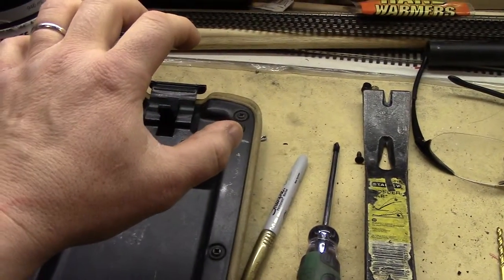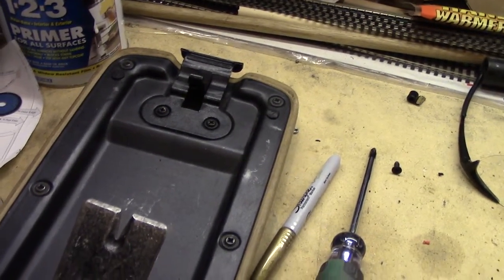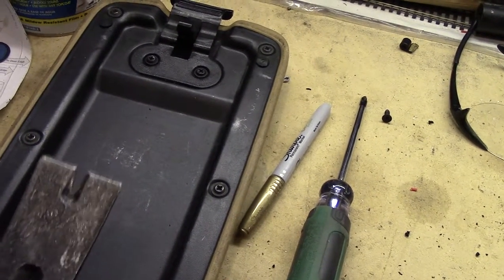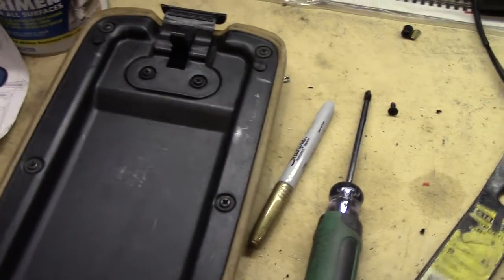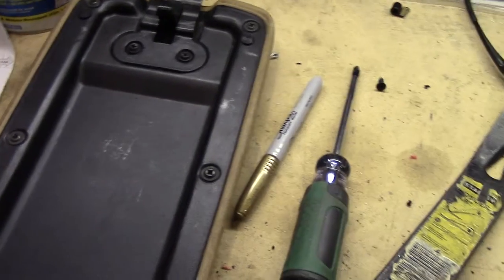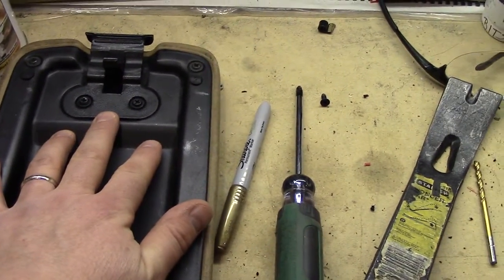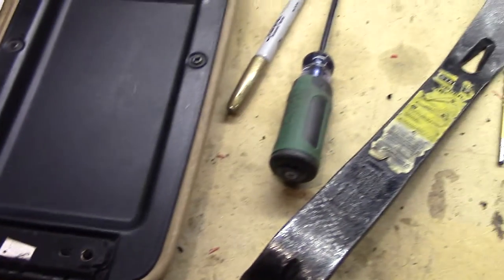You're going to pull it out of its leather holder, then slide the ribbon bar in from the back along with the cup holder extended, and very gently pry the two pieces apart so the plastic clips that lock together are able to slide out. That lets you slide out the cup holder portion, then pull out the center portion of the Grand Cherokee's armrest, giving you access to the hinge — which is what you really need to get to in order to make the modifications.